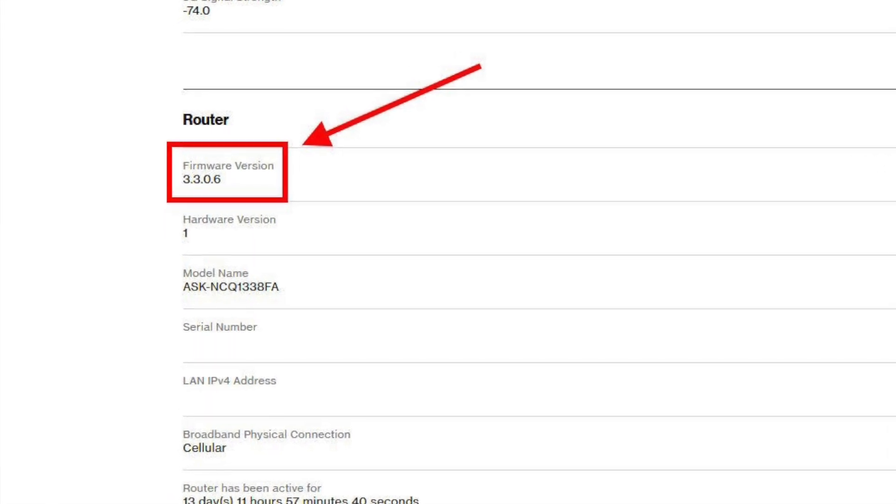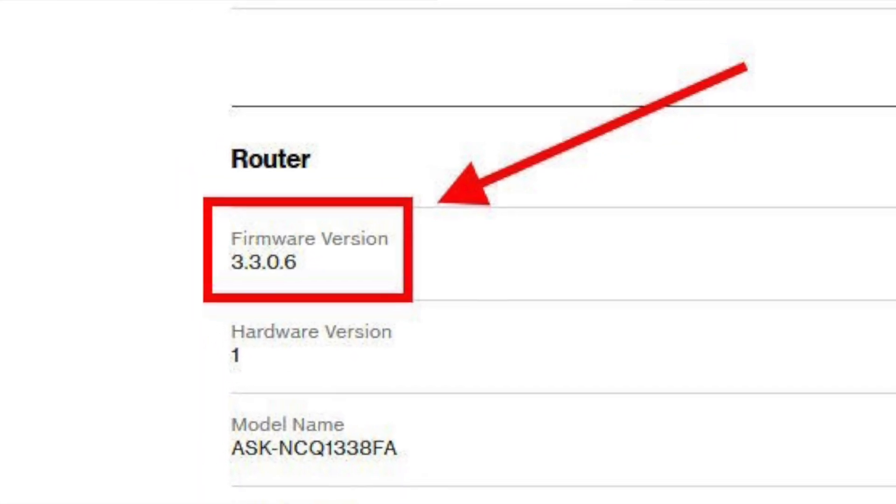So the process is very different from what it was back then. I would use an Ethernet cable to do these setting changes. The reason is that you'll be turning off Wi-Fi at a certain point in this process, and if you do it through Wi-Fi, you'll lose control over the gateway at that point, and if you want to make changes, you just won't be able to, and you'll have to do a factory reset on the box and start all over again.